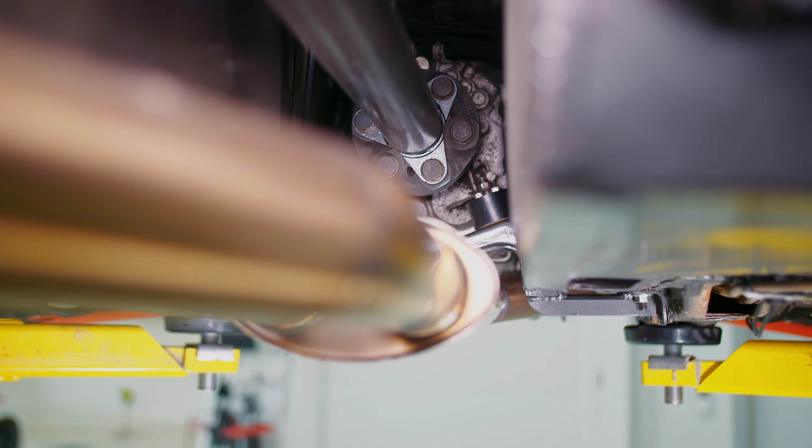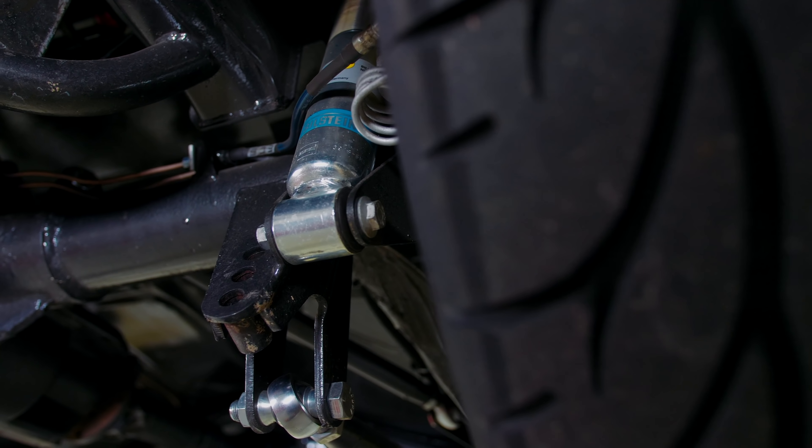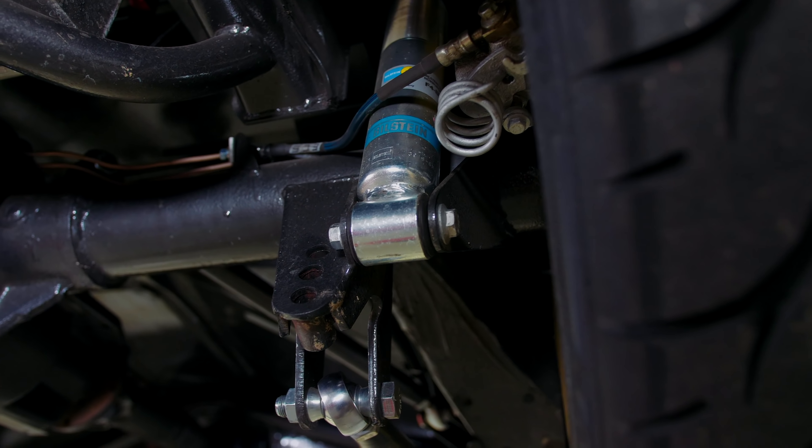I'm on my third revision of the geometry — pretty happy with it, might take a little Ackermann angle out in the future. I've got Hawk pads and rotors which make it stop awesome, and for this car I really need that. The headers are wrapped now — last time they didn't have collectors, but I've figured those out. I used ECS universal exhaust parts, mandrel bends you can piece together however you want, to make all the pipes, an X-pipe, back to a resonator, and then straight-piped the rest of the way. In my opinion it sounds pretty good. As some of you pointed out, the driveshaft isn't straightforward — BMW used a flex disc instead of a U-joint at the back of the driveshaft, just a rubber coupler with three bolt holes on either side that allows for misalignment.